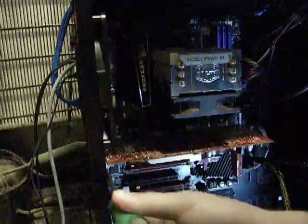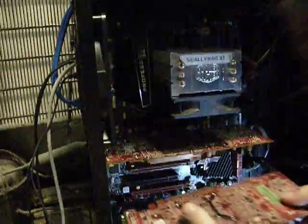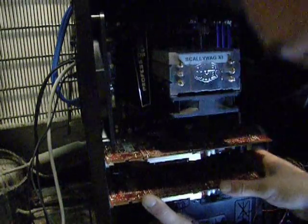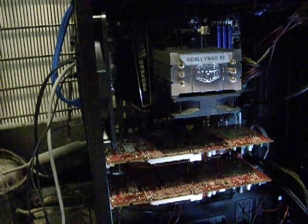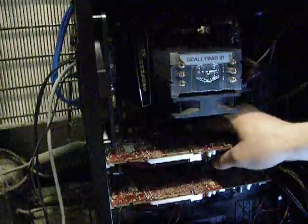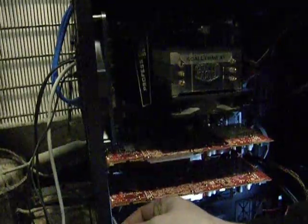I'm kind of thankful for that, because tool-less slots do have a weird tendency to sag or just droop. So the bigger your card, the more you should probably make sure that you can screw your video cards in. I put the second card in and it's locked in — there's usually a little tab right there that'll move and click. Mine didn't, but usually they do.